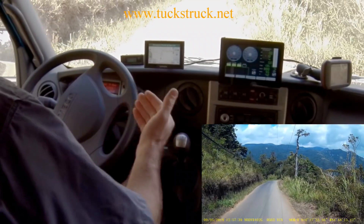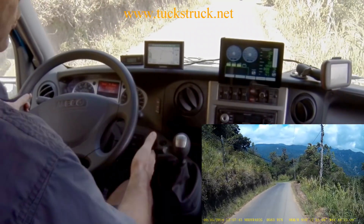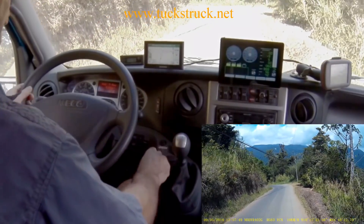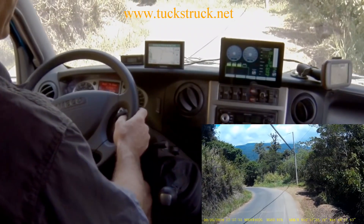The nice thing with the retarder is it's going in through the power takeoff. It's almost too much there so I'm going to go down to one stage of retarder. I can do a nice gear change — the vehicle won't run away because the retarder is holding it back. I'll put two stages on for the gear change, in on the clutch, nice slow change into second gear, and I can take the retarder off again.